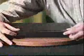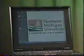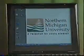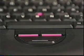Now to open the ThinkPad, slide the two latches on the front of it to the outside. The ThinkPad model leased to you is the 1300i NMU with an Intel processor. Some features include a color LCD screen with an active matrix. There is not a mouse, but instead a TrackPoint system with left and right click buttons located below the space bar. The middle click button can be used to enable scrolling. There is also a place to plug in an external mouse if you choose.